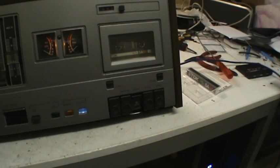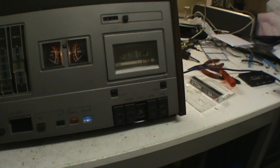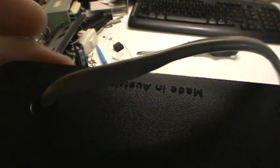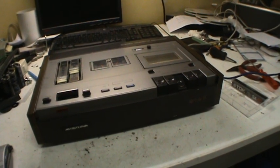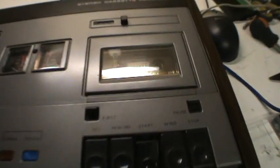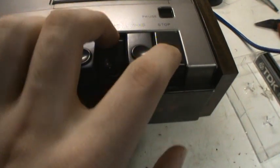This thing is quite simple and quite nice looking. You have the two microphone inputs underneath the little door that slides down, record level sliders, a set of VU meters, counter, cassette door, eject lever, pause lever, and the controls: record, rewind, start, wind, stop. On the back: tape in, tape out, line in, line out, DIN input, power input, and a fuse behind the door. It has a dynamic noise limiter which is nowhere near Dolby — it just basically doesn't do anything to the sound. I wonder if it even works. Anyway let's rewind and see what this thing sounds like — probably dull because the head's worn out.